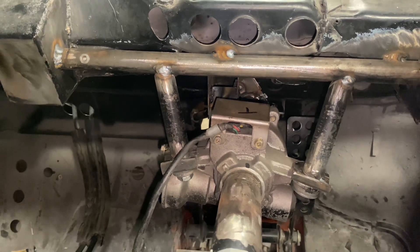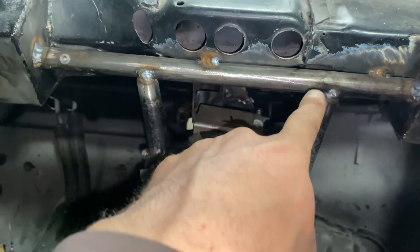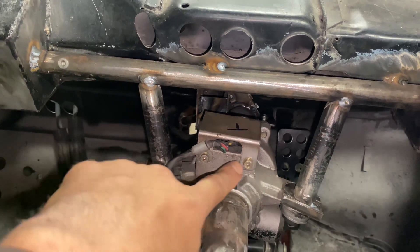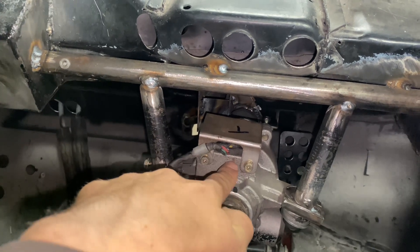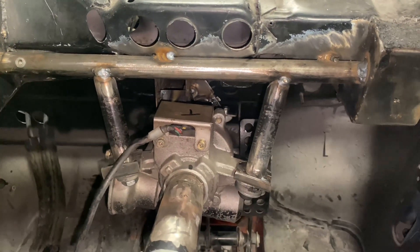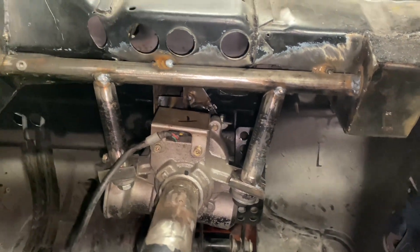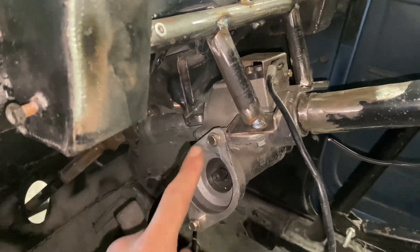The other thing I think I'll do once I've fully welded this up, just to strengthen it a little bit more, is put a gusset right in between these two bars. There are actually two little threaded mounting points here, so in the gusset I'm just going to have two little holes and then this part of the steering column can also bolt to the gusset strengthening plate as well. I think that should be more than strong enough for the top section — I could always triangulate it back up here, but I think it should be fine with that setup.